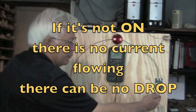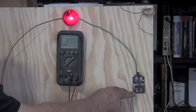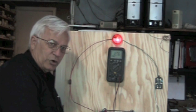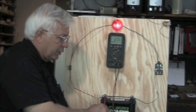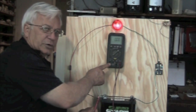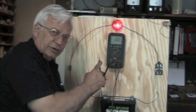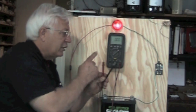In this case, all we have is a light, so we're going to turn that light on. We've got our switch connected — it's a closed circuit and our light is on. Now we're going to retest and do a voltage drop test. I'm going to take the positive side off of the voltmeter. Remember, the negative side is still attached, so the voltmeter has a ground supplied to it. The voltmeter is going to measure the voltage differential — the potential difference, or the pressure difference, between the negative and the positive. That's what this reads.